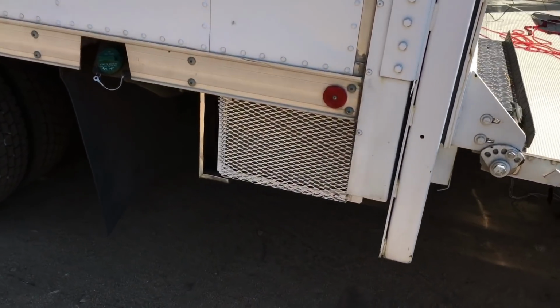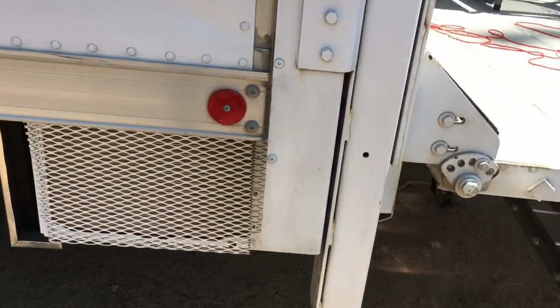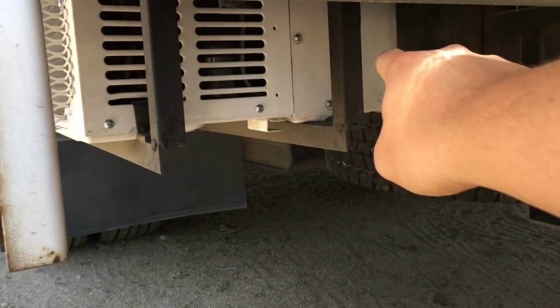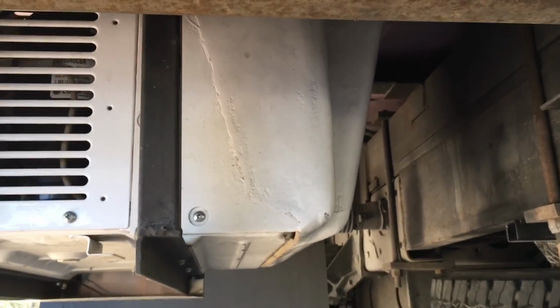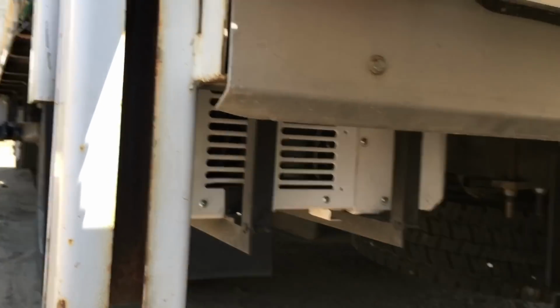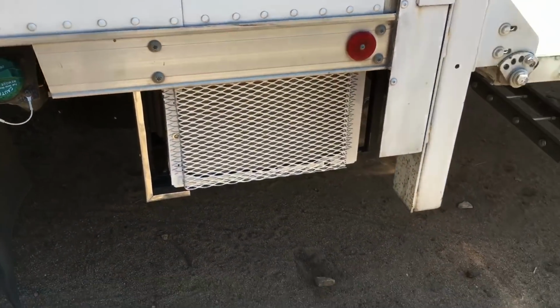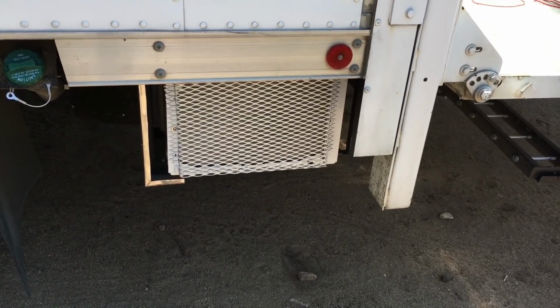This is a 5000 BTU window unit, which I've modified. Look under here, there's a custom fiberglass plenum that I made. Kind of hard to see, but that redirects the return and the vents up through the floor. And I can show you that when we go inside. And the controls have been pulled out, and it runs off of just a programmable house thermostat.